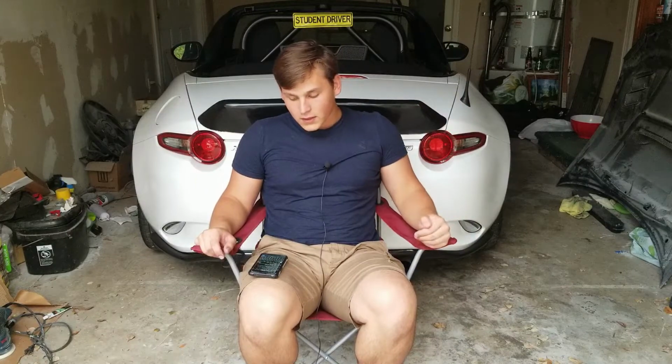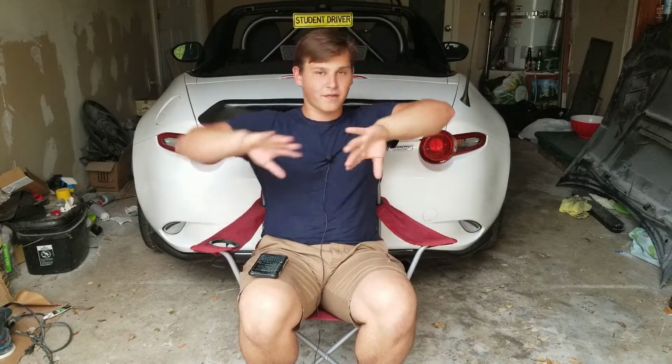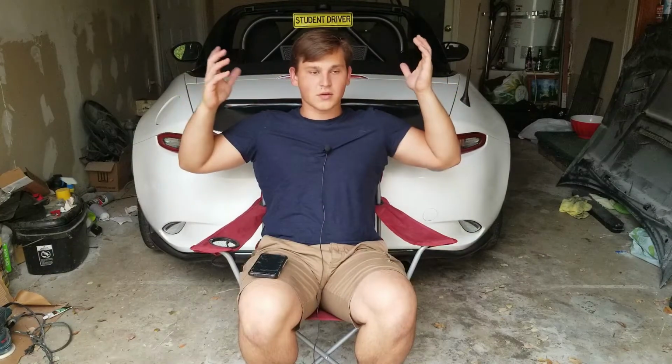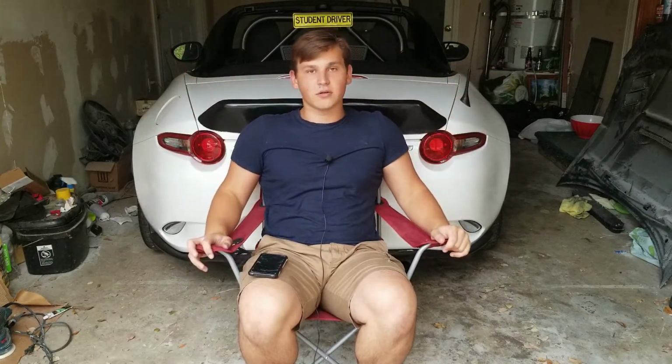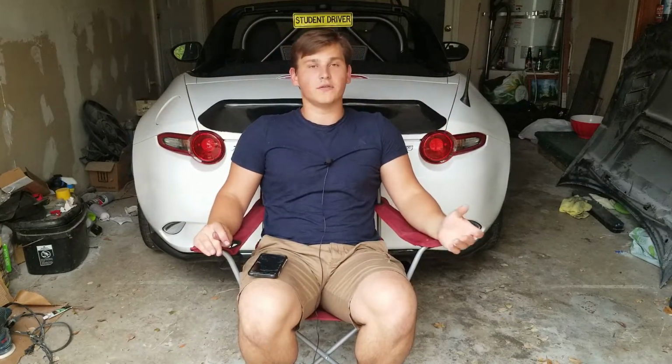After I made the mold, I covered the inside with Bondo and made it as flat as I physically could, so that it would be the general size of what I wanted and so that it would have almost no imperfections. I should have spent more time on that, but I was kind of rushing it at this point because I wanted to finish it as soon as possible, which ended up not happening in the end. So I probably should have taken more time.